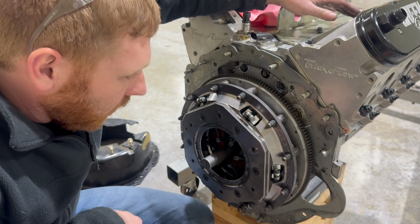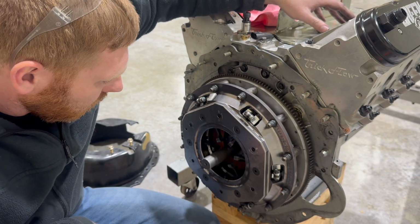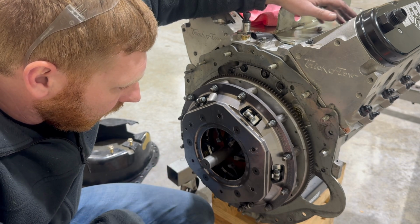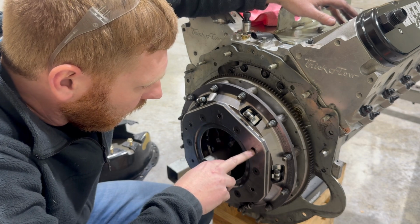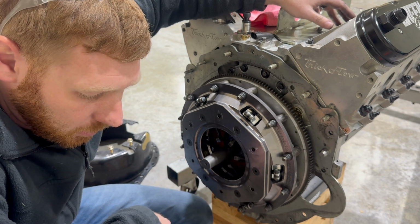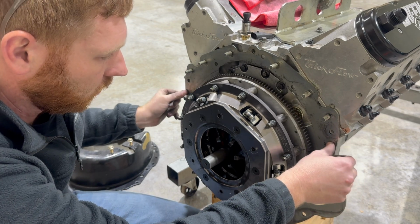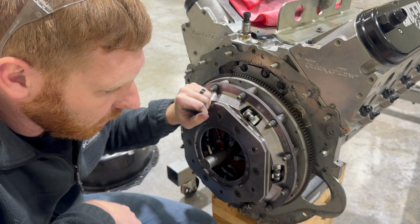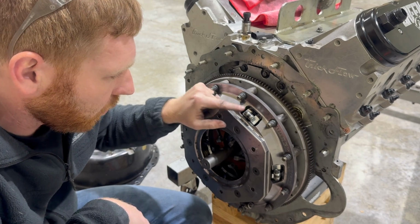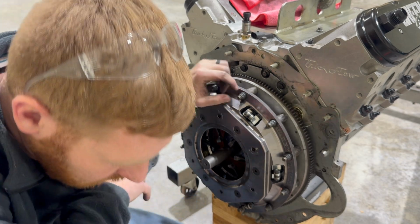We had 2.5 turns base and 74 grams total on counterweights. Now we went to about 90 grams roundabout and 4 turns base. Should be a lot tighter so that they can make the dyno pulls. We'll go back to those settings. We'll go back to the track and start there. Even though we got way more torque, we may end up with some more base, even some more weight, or both. This clutch tune might be good. We'll see.